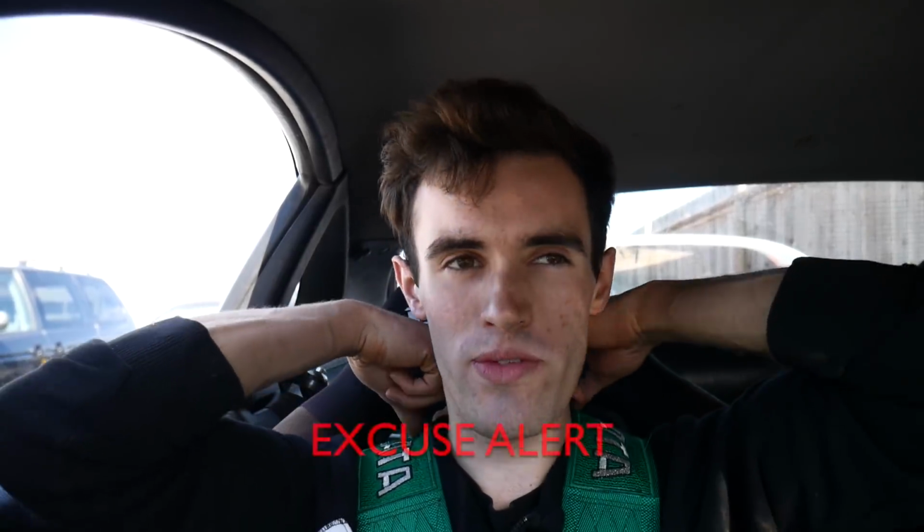Alright guys, there you have it. Supra is finally tuned. So as you saw, it made 430 wheel and around 400 foot-pounds of torque. Keep in mind this is a Mustang dyno, so it reads about 12 to 15% lower. I've been offered to dyno my car on a Dyno Dynamics dyno. I just said dyno a lot. Apparently they read more accurately, so we'll see.